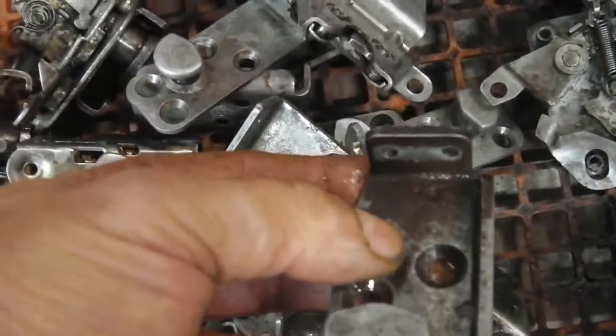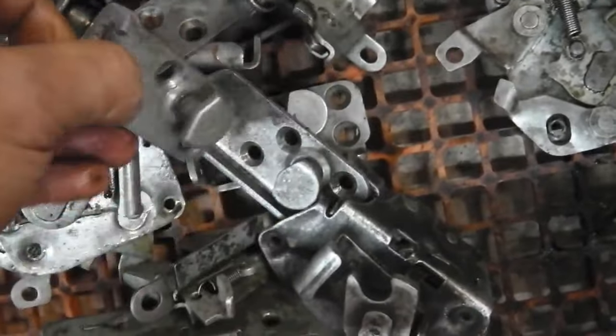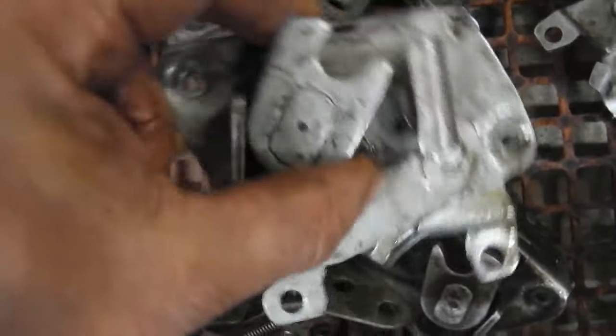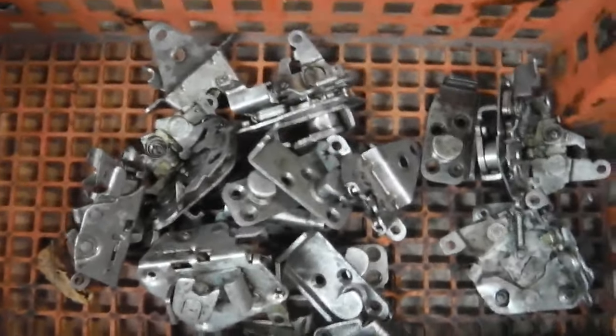Good enough, depending on how high you want to go with your level of work. For me, I just want to see there's some pitting in that one. It's not touching it. Others, it's really good. So it just depends, but I'm going to get him to just dust the fronts of each one, the high-vis section of each part. There's no need for him to go into the back, and then I'll air blast these out. Here we go. Off to the shot blaster with these ones to finish them.